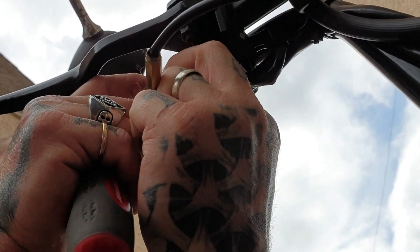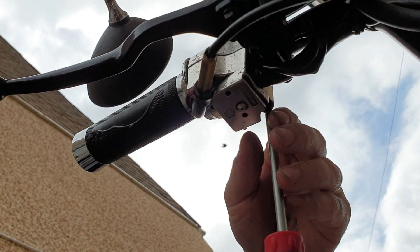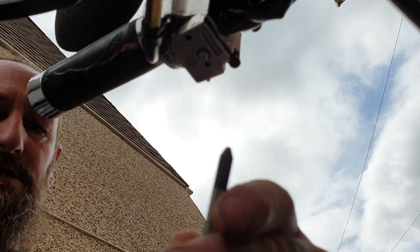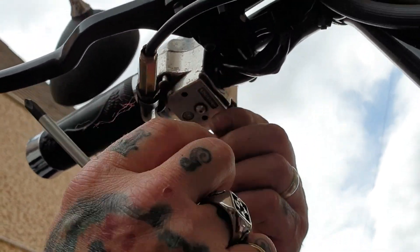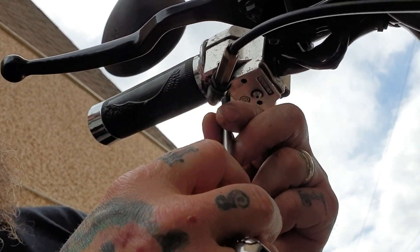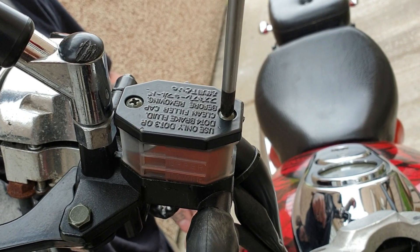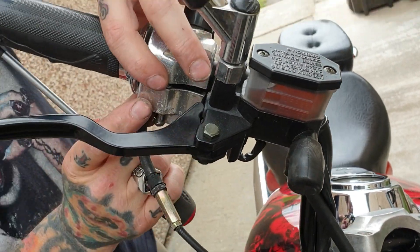Because it's a Chinese/Japanese bike, we're using a JIS screwdriver, which as you all should know by now stands for Japanese Industry Standard. It's slightly different to our Phillips or Pozidrive. You can pick them up online — a set of four for about 15 to 20 pounds here in the UK. They're worth getting because they lock into the screws a lot easier, especially on things like a brake reservoir where it's a positive fit. A normal Phillips screwdriver will always have that little cam-out.